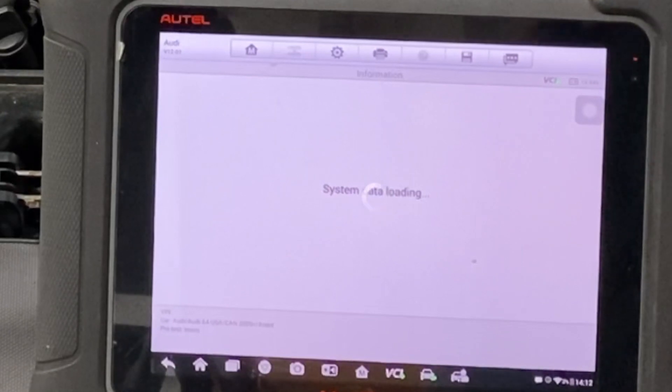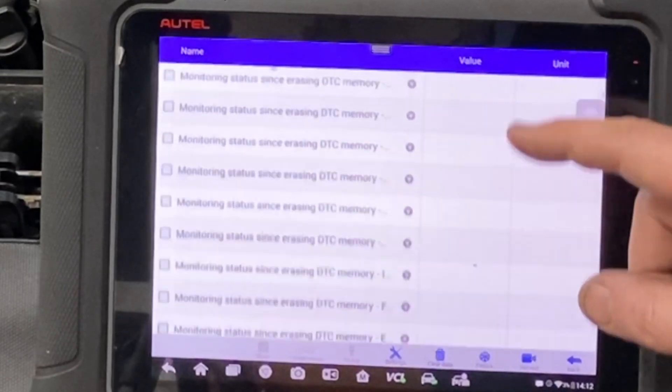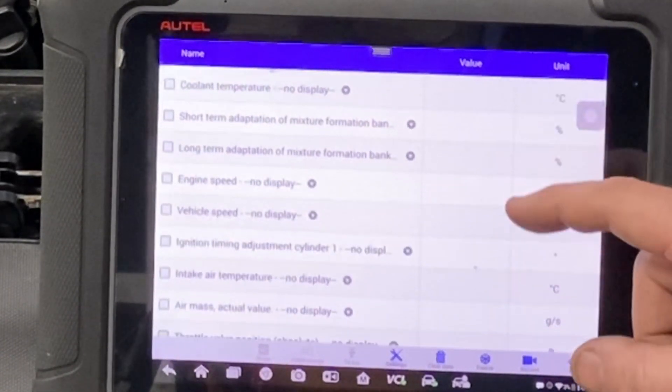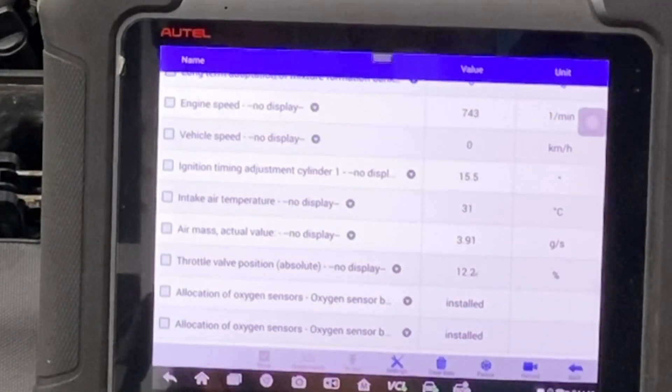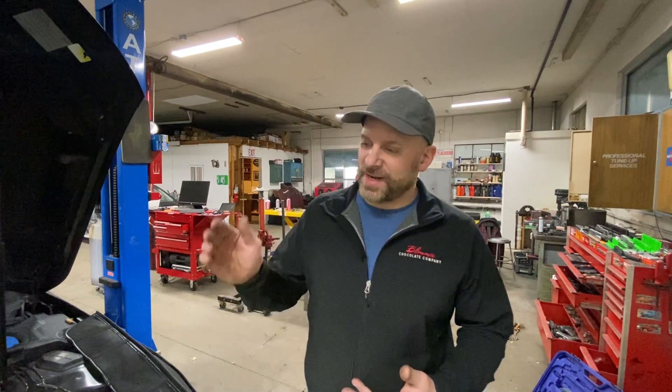Before we just read zero grams per second. I think it's still in there — it's going to go out quickly. There you go. That's a quick demonstration of how you should always check your power and grounds, because sometimes that part cannon doesn't hit the target and you'll have to go back and diagnose it again. And in this case, I had a broken wire.